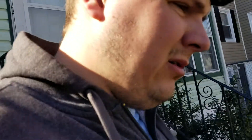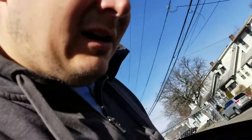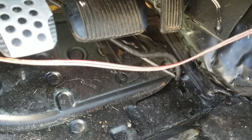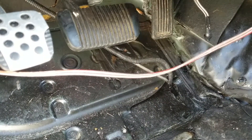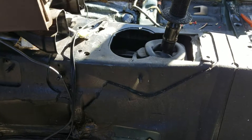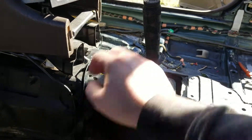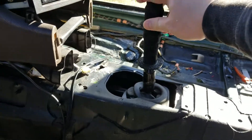I have all my parts ready and good to go. So today I'm gonna be working on pulling the clutch pedal and redoing that assembly because it's pretty shitty. The way the previous guy did it, he ran a line from the clutch pedal itself and just drilled it in. This is a CD009 transmission — the 350Z trans from that year.